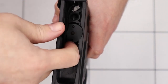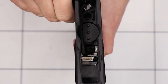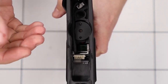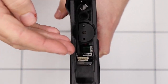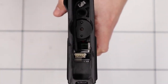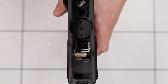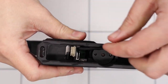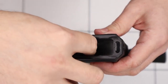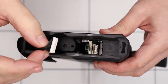With that done, we can tease this wire up here and then remove it. As with all connections on the Deltwolf, we need to be incredibly careful as we remove them. You always want to be gripping the connection itself — the white piece itself, or by the bulk of the wires. Just like when we disconnected the battery, we need to be careful not to pull on any individual small wire. So to remove this back connection, I'm just going to tease the wire up nice and carefully, then by getting a good grip on the connection itself, gently pull up and remove it.